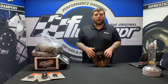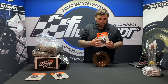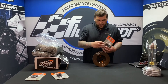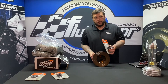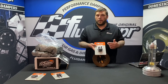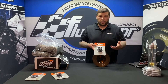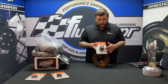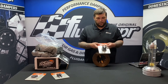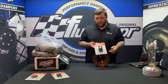If you're going to push over 700 horsepower, we do recommend our full power kit. It comes with four ARP bolts with washers, our torque plate, and our diamond-encrusted washer. The torque plate has a machined finish that helps bite in on the front, and the diamond washer goes between the crank and the back of the damper. The OE bolts are torqued to yield and need to be replaced every time the damper comes off, but ARP bolts are multiple-use. The torque plate also has a 5/8 socket head so you can hold the engine when tightening the damper or barring the engine over.